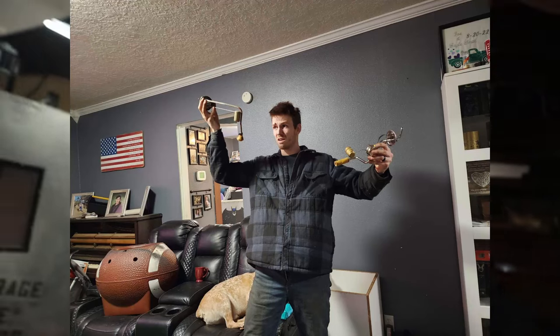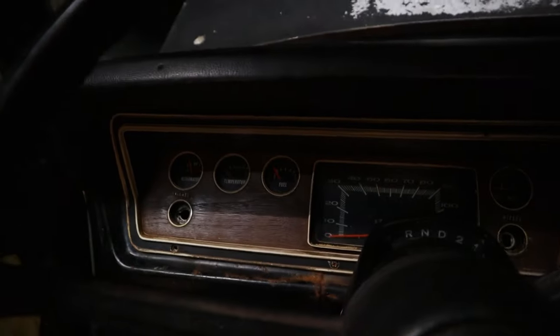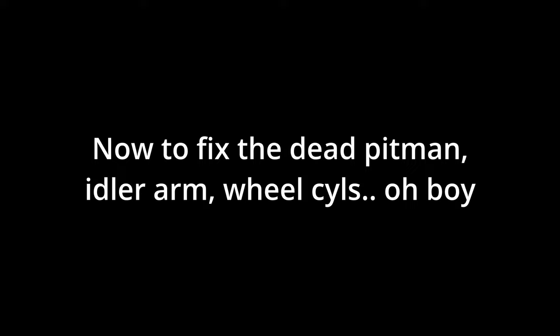Well, it turns out it was the sending unit the whole time. This is the stock sending unit — it's not the same shape, not close. The Classic Industries replacement sending unit is a completely different shape and completely different throw — everything. But look at that: quarter tank is what it's reading, and I roughly have a quarter tank. Turn it off and it slowly drops back down. We have a gas gauge! We have a running car. We have all the bits to be a fun hot rod — shocks, gaskets, carburetor, intake manifold. But that's all time and things for a different video. Like, comment, subscribe, stay tuned for more content. Enjoy your night, guys — catch you on the next one.